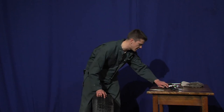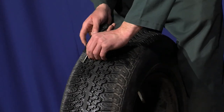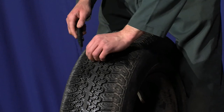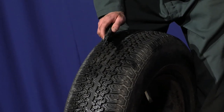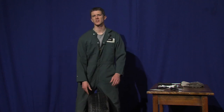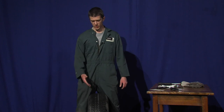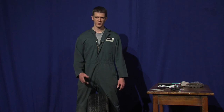Next you just need to cut off those little tail ends. Grab a razor blade, grab it by the tails, and cut it as close to the tread as you can — that way you won't feel it as you're going down the freeway. Now this is a temporary fix, so ideally you're going to patch your tire, not just plug it, because this won't last forever, but it will help you get back on the road so you won't have to drop your spare tire. This has been how to plug a tire with Chris. Join us next week when we talk about the top 10 reasons why you should buy a sweet car. We'll see you next week.